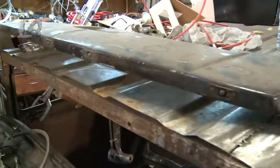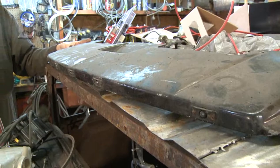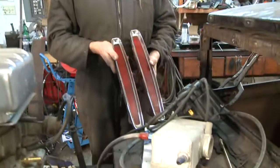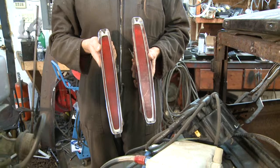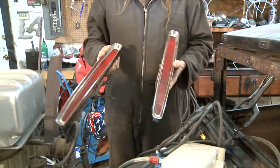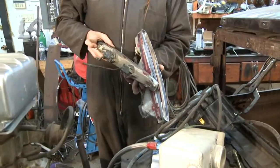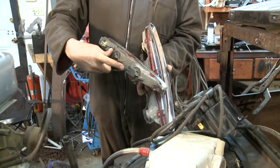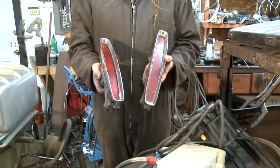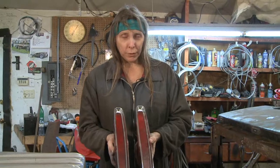The votes are in. The visor that I was hoping to use, I will use — it is a fiberglass visor. I will treat it to have a patina to look like the rat rod, and I'll show you how I do my own patina. Also the votes were in for the taillights from the Cadillac. I was going to cheap out and put other lights on quickly, but frenching these in actually looked better. We tried different variations and it looks like up-and-down orientation is going to be pretty good on each side of the car. They have three lights in them — parking light, flasher and brake light, and another parking light with an extra brake light. All I have to do is cut the body out and French them in. You can pick these up at a scrapper pretty cheap; they're available at any Cadillac from the 90s.